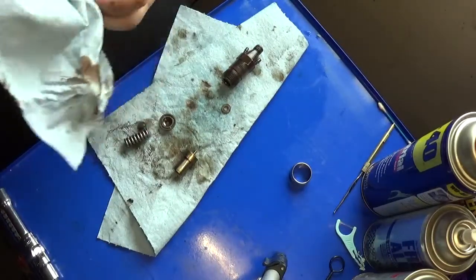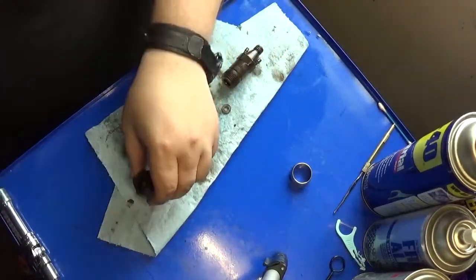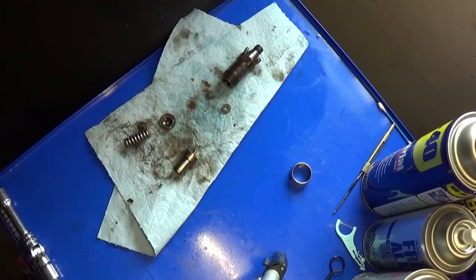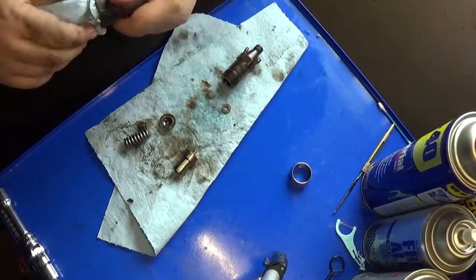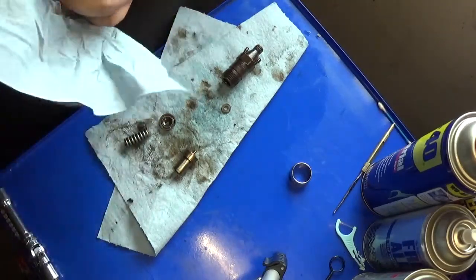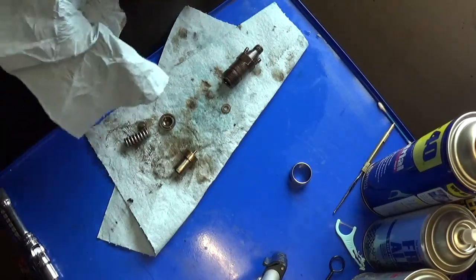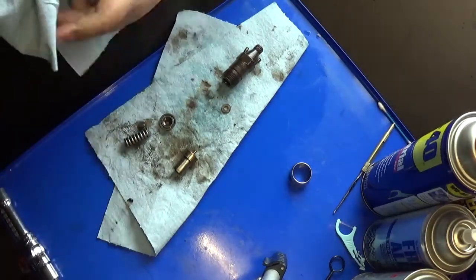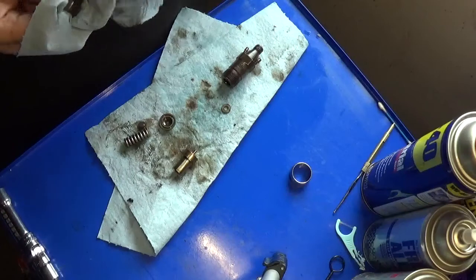Got the kitty wanting to be in on the shot. I've already cleaned two of these injectors out. Why would you want to clean these out? Well, if your motor is just hammering and you can't get it to run right, or you can barely get it to run at all, that's when you're going to want to clean these injectors out. If you've got smoke coming out of the tailpipe, that's when you're going to want to pull these injectors.